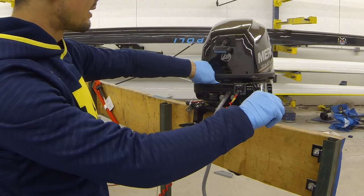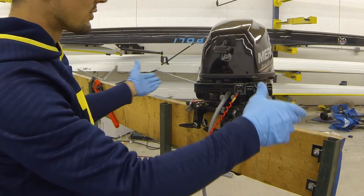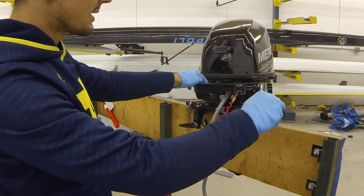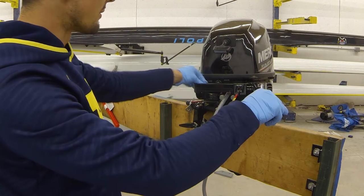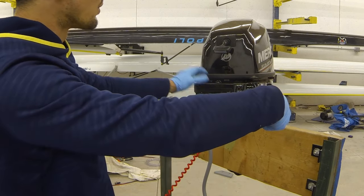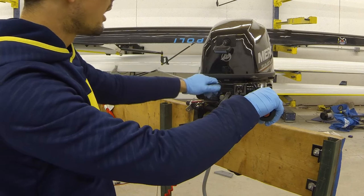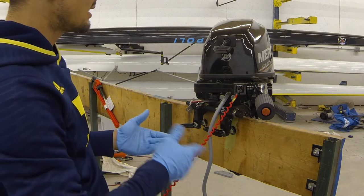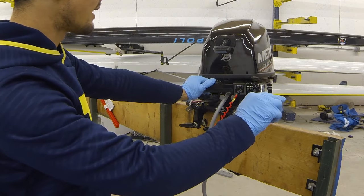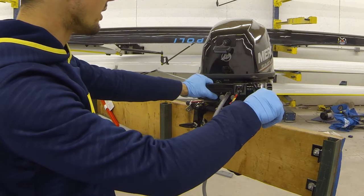We've got our red light on here — that red light shows us that the oil pressure warning system is working. We'll go ahead and turn our choke switch off; the motor's running good. Typically we want to leave the choke switch on for about 15 to 30 seconds on a really cold morning, maybe even longer, to let the motor warm up, then turn it off before we start going. You do not want to motor down the river with the choke switch on — that'll foul up the spark plugs and gives the motor too much fuel. If the red light comes on during practice while you're using the motor, it means you're low on oil. Shut the motor off right away, go back to the dock, refill with oil, and figure out why you're low — whether it drained out or there's a leak.